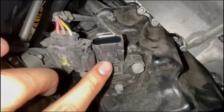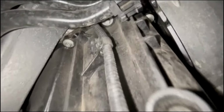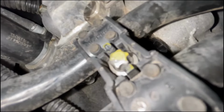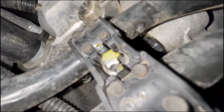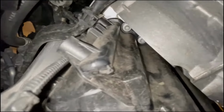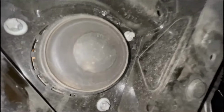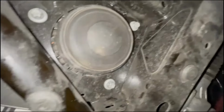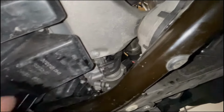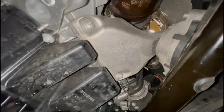Okay, disconnected the oil sensor, and now up here, there's this guy I need to remove from the oil pan now. I think that's an E10, we'll check it out. And then we need to jack up the engine, so we'll be disconnecting the motor mount from underneath. It's actually very, very easy. And then there'll be a jack right here. And it'll go straight up on this arm and push up this entire side, and hopefully that lifts it enough to give us clearance to remove this oil pan.